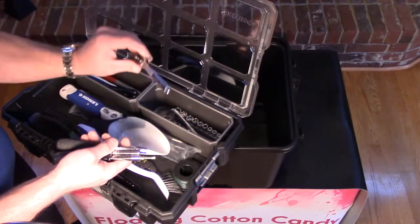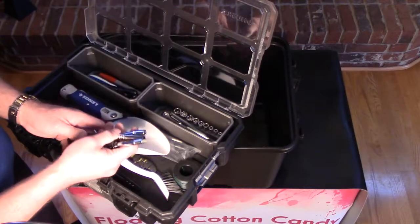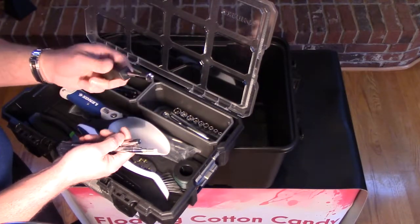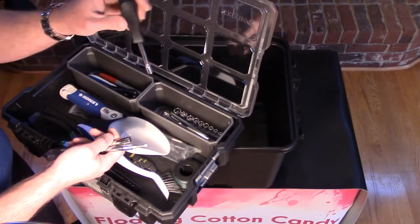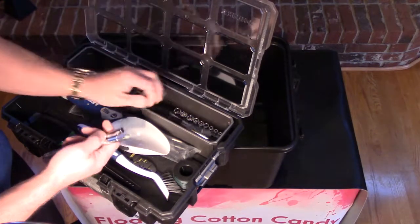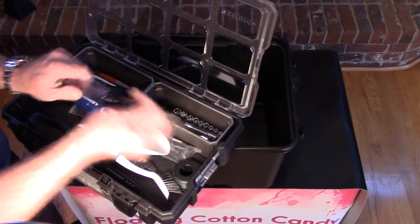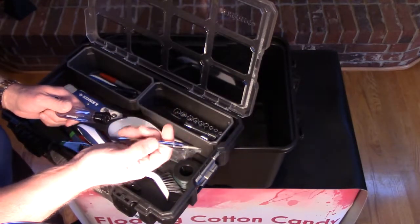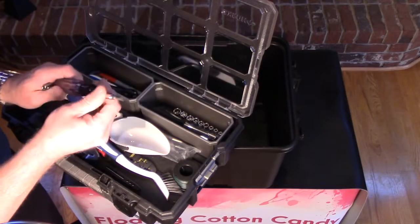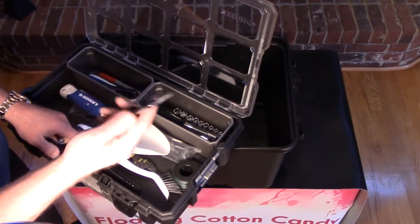A 1/4 inch drive, you don't really need more of that for most operations. A nut driver with the 7mm nut already removed from that set and put on because that's for the electrical connections for releasing the coil. A little multi-change driver that gives you 2 different sizes of standard and Phillips because that is going to pretty much just be that one driver there. Allows you to take everything you need off for cleaning.